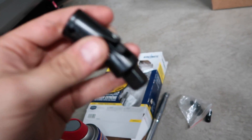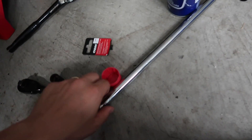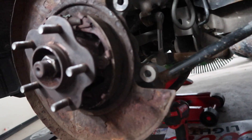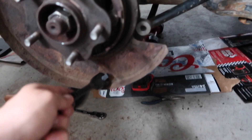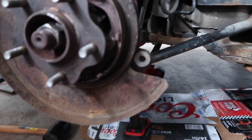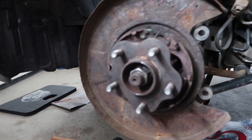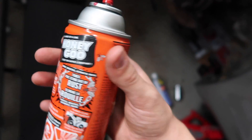It's made for an impact gun, but we'll see how tough it actually is. I've tried everything, man — I can't get the breaker bar underneath because there's just not enough room. I'm at a standstill right now. I could easily send this into the shop, but look at this whole thing. We're trying to do the dual caliper setup. I have tried the penetrating oil and I've broken three bolts out of the five on the CV axle, so I'm definitely getting somewhere, but it's a slow process.